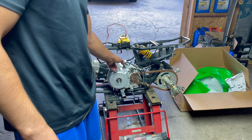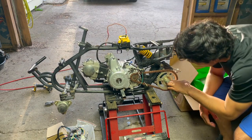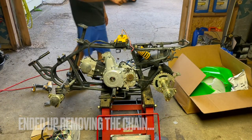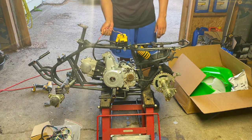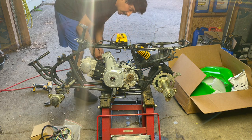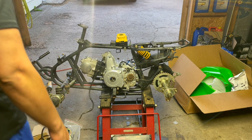I'm going to pull the stator cover and see if the starter chain is still on there. It sounds like the starter is spinning and nothing else is spinning, which makes me nervous. I almost think that motor is locked up. I got to turn over — now that I got the chain off, the chain just rusted almost completely flat. The compression test is sitting right under 100 PSI. I'm going to pull the starter off and go from there — a little more work than I was expecting.